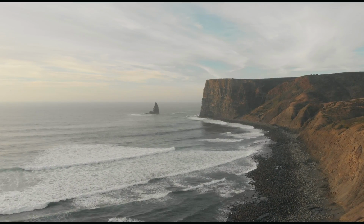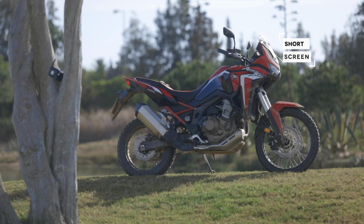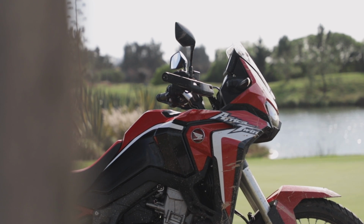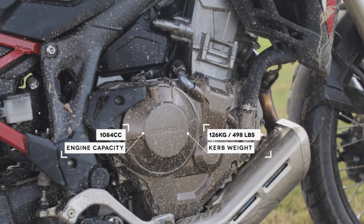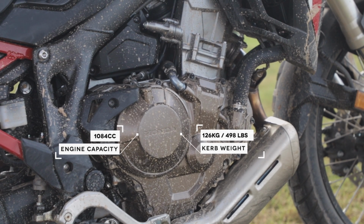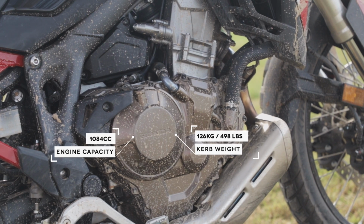One of the trends we've seen a lot over the last 18 months is bikes becoming more focused. So bikes are getting lighter, they're becoming more deliberate in the direction and the design, and less of an overall package than maybe they used to be. With that focusing in direction, Honda have made some significant changes to the Africa Twin. They've lopped the top off the screen on the standard model so that it interferes less with you when you're riding off-road. They've also changed the frame so that the new one is lighter, it's a slightly different shape, it's definitely lost some weight, and they've paired that with a swing arm which is very similar to the swing arm off their CRF 450R motocross bike.